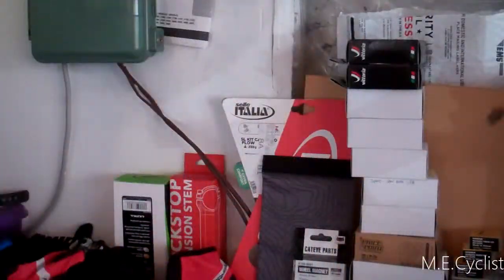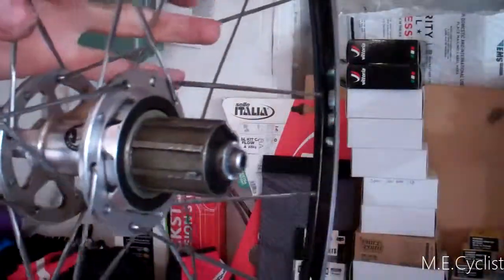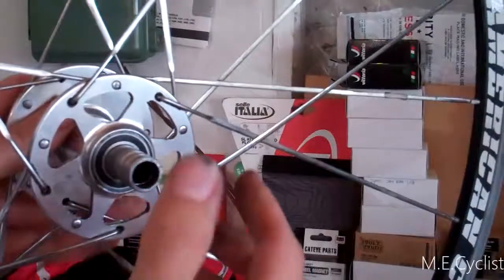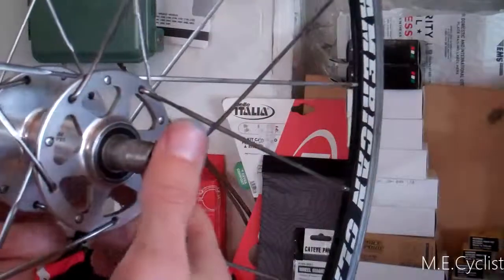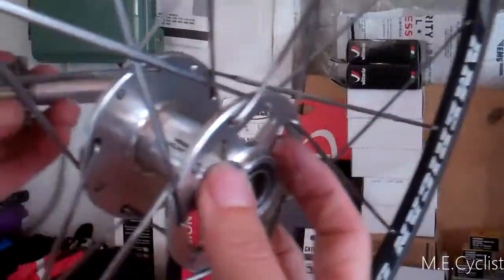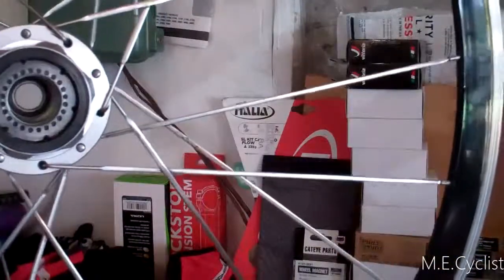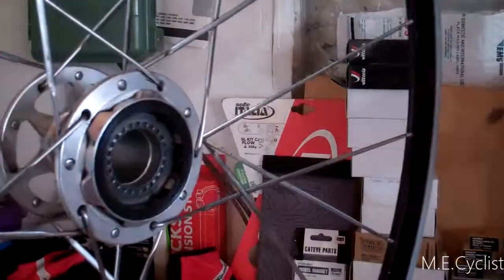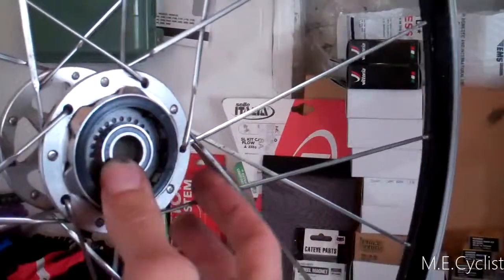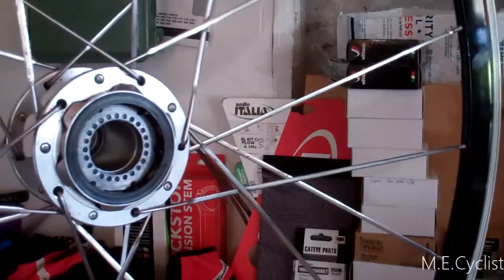If you're lucky you can just push the freehub back out; you might have to gently persuade it. There's your freehub. One bearing on this side, and this will also have a bearing — there's the other one right here. This goes in on this side, and this will also have a bearing with the little ratchet ring. That's where the other hub bearing goes.